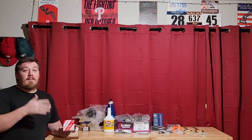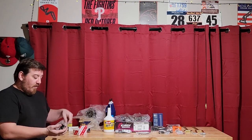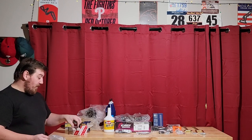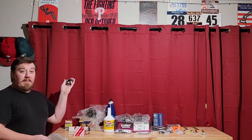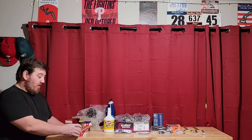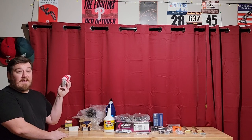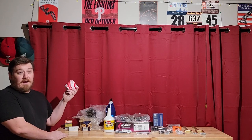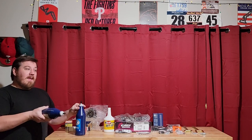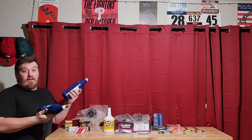I got a nice clutch here — an Exedy kit. No matter what, if you ever read about people running these clutches in daily drivers, the problem is the throwout bearings are all cheap Chinese parts. So we are going to put a Toyota OEM throwout bearing in here — specifically a red box Toyota throwout bearing with the clip and all that. That's a must-have, even though it's a little more than I'd like to spend on something as simple as a throwout bearing.